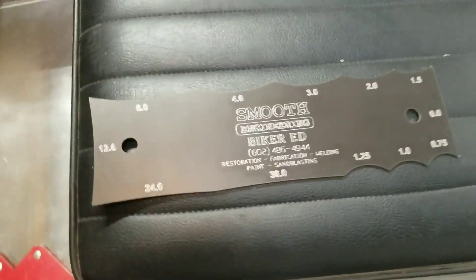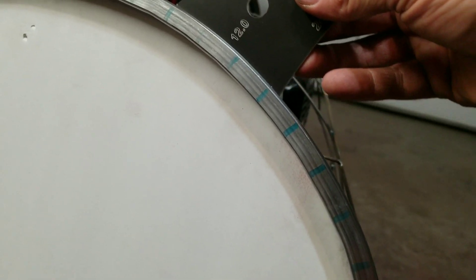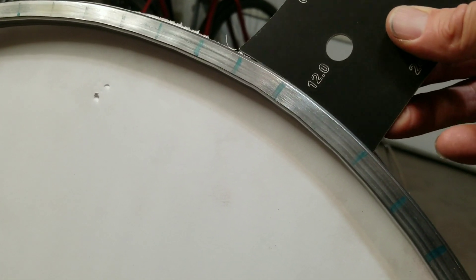There are different numbers on here that tell you the radius — a four inch radius, for example, and a 12. This radius is not quite a 12; it's more like a 10 but really close. You can kind of rock it back and forth and tell where you've got flat spots — you can see daylight appear or disappear or how much it rocks. Right there it doesn't rock; a little bit of a flat spot compared to right here where it's a little bit more arched. It's real helpful to dial it in or at least get closer. This doesn't have to be dead-on perfect — it's going to get aluminum body on top of it, so we'll have a little opportunity to fill some of that shape in at that point. It's really hard to get it perfect because when you bend one part, it starts to move around in another.